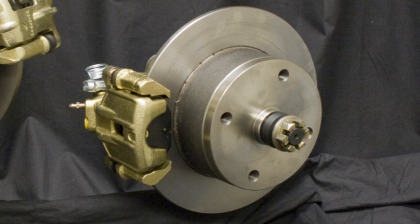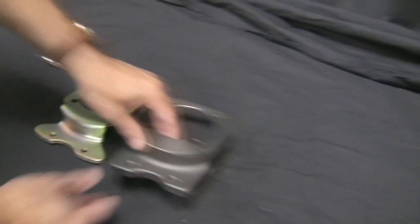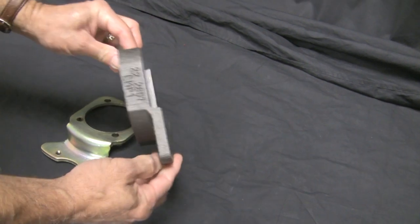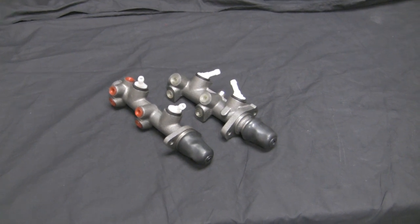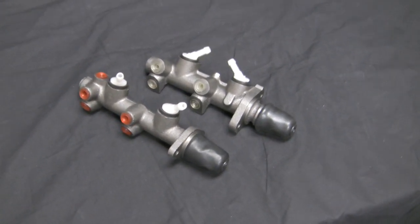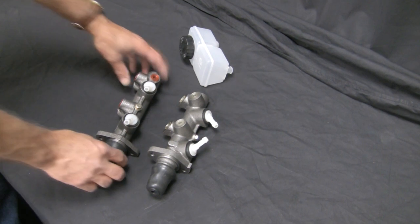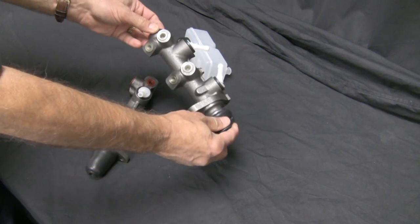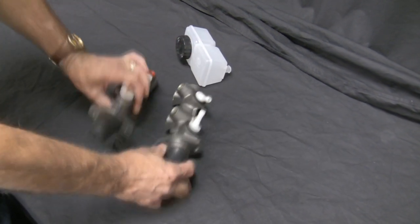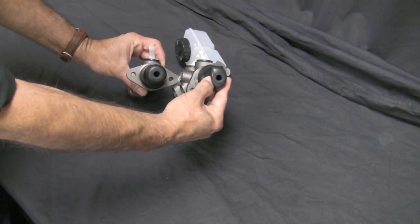If you want to carry the upgrades that disc brakes offer to all four wheels, Empey offers rear disc brake kits as well. We offer kits in different configurations. The Econo kits have stamped steel caliper brackets, while the more preferable deluxe kits feature cast steel brackets. If you are installing four-wheel disc brakes, then a master cylinder designed for four-wheel discs must be used. Not using the correct master cylinder is a source of installation failure. Empey offers a 20.6 millimeter bore dual circuit master cylinder that will supply the correct pressure and bias.